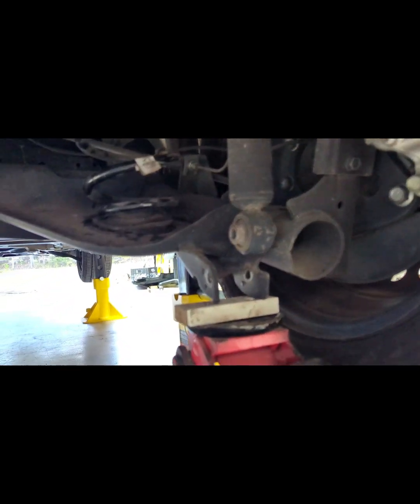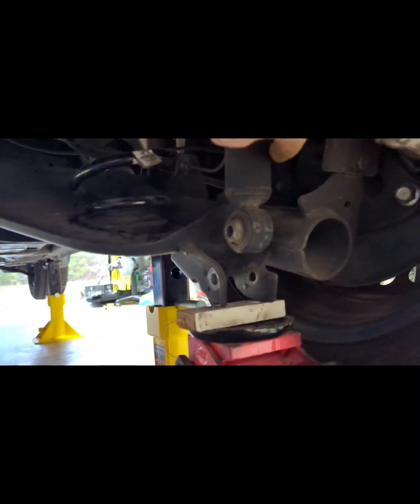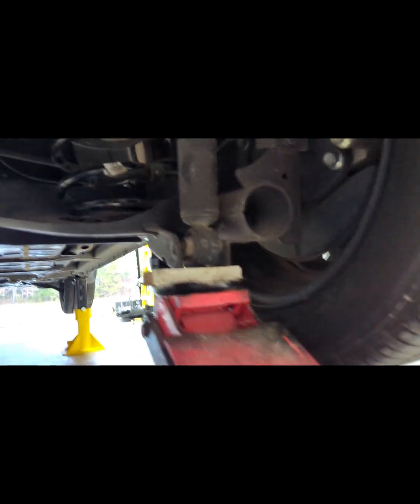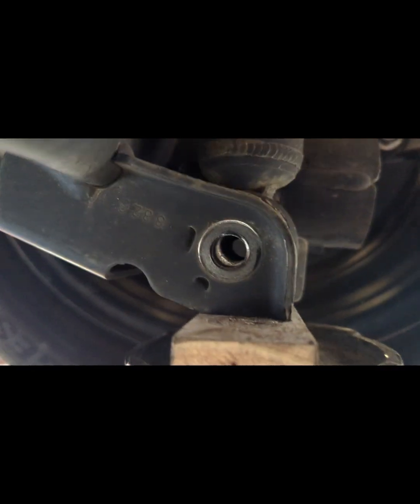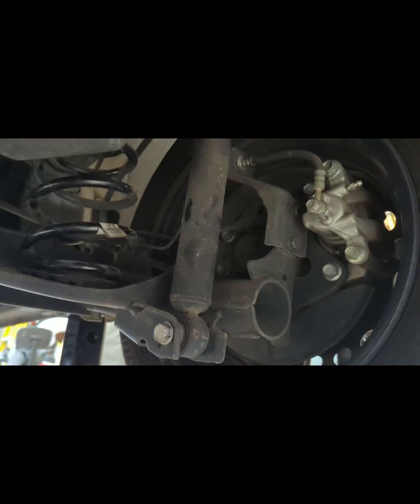This is going to be a little bit of a pain but I'm going to show how you get this thing back up in here. I moved the jack over — it's moving and wobbling free so just make sure it doesn't get bound up when you start raising it. If I were a smarter man I'd be replacing these shocks at the same time but I just don't have time for that right now. Just turn it a little bit, get it in there, jack jack jack, and at a certain point this will fit that hole perfectly. The new springs are in place — this whole job took less than half an hour, which was really not bad.